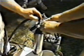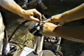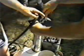And then when you back off on the accelerator and go for the brakes, you should have manifold vacuum. But what happens is that the pressure in the cylinders, by the bowing outwards, transfers into the manifold, and you seem to race ahead when you go for the brakes. There is none, because you have no manifold vacuum. It's just transferred that pressure into the manifold, whereas a solid unit does the complete opposite.